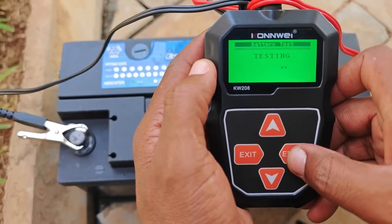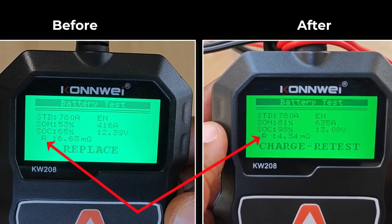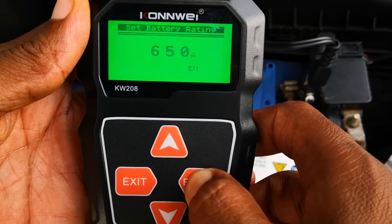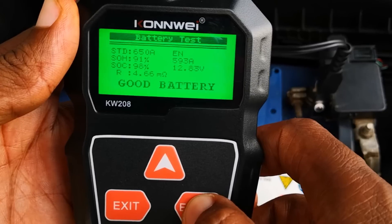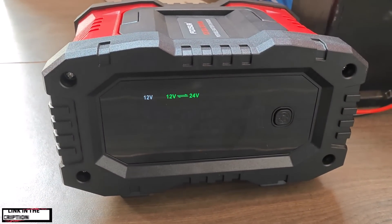16 hours later and the repair is done. State of health has gained approximately 30 percentage points and internal resistance has dropped below 5 milli-ohms. State of charge is now at 98%. I'm generally not concerned about the charge-and-retest verdict — I've had this a couple of times after charging my Bosch battery and it will usually give the all clear after some cycles of use. My guess is that this is possibly down to interference from surface charge, which is a false state of extra charge that you find on batteries right after they go through any of these maintenance procedures.